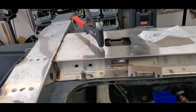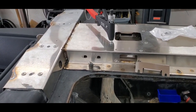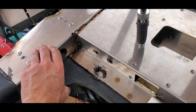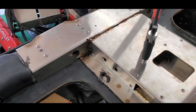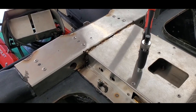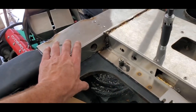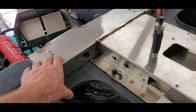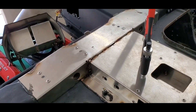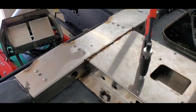One other thing: I would still recommend removing the headliner when repairing an existing roof box, because you need to physically draw it down, and without the bolts you can't really do that. The workflow would be: pull the headliner off, clamp your lifting roof box down, then drill quarter-inch holes and use quarter-inch rivets. You'll need a different rivet gun for that, but they are substantially larger than three-sixteenths.